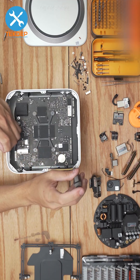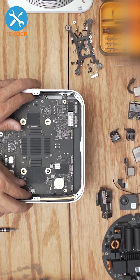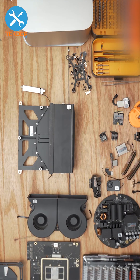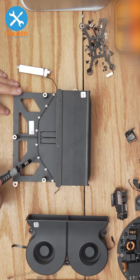Remove the other Wi-Fi antennas and unscrew the cooling unit from the motherboard. Remove the four screws along the perimeter of the motherboard. Flipping the logic board over, you can get a look at that M1 Max Mac Studio chip. After removing the fans, we can finally access the T5 screws that hold the third Wi-Fi antenna in and remove them.